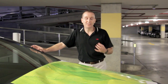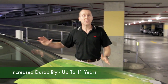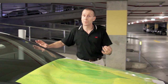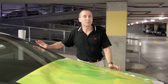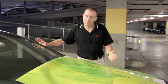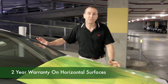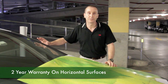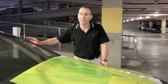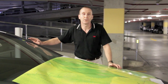The second big advantage of the Envision 480CV3 is its durability. The unprinted film on a vertical surface actually has an expected durability of 11 years. When it's printed on a vertical surface and laminated with the 8548G over laminate, it has up to a warranty of seven years. And best of all, when laminated with the 8548G laminate on a horizontal surface — such as the bonnet, roof or boot lid of cars — you actually get a two year warranty on that application.